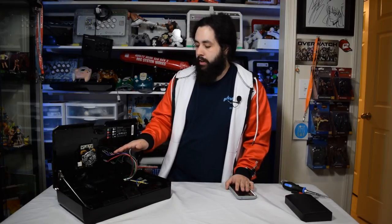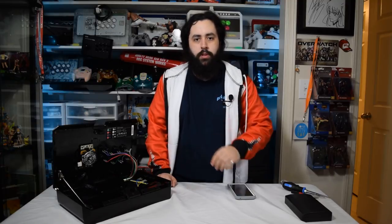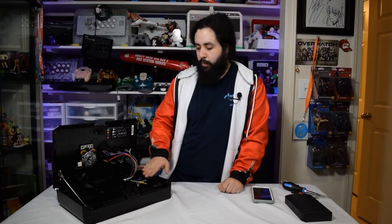I know that even on this, the Fusion, the very first stick that I have, when I did the modifications on it, I literally wrote on the metal plate next to each button R, G, B, abbreviations for red, green, blue, for whatever went with each button, just so that I would remember it. And that's generally a good practice. So try and find some way that's convenient, or have some sort of reference, so that you know immediately where to put everything back after you switch the buttons out.